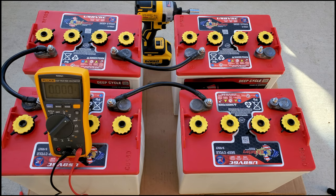If your golf cart does not move, you can go to the next step by first making sure you have a clean connection with all your cables and battery terminals, and then checking to see how many volts are in your batteries. The simple way to do this is with a multimeter.